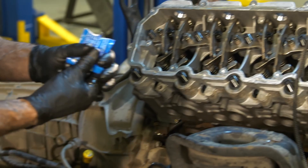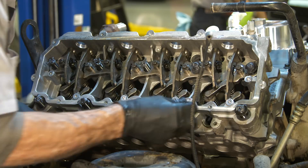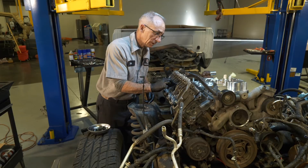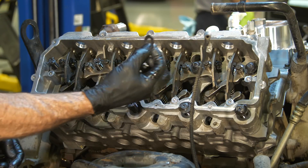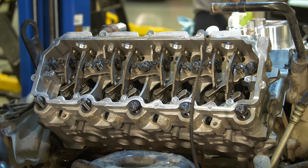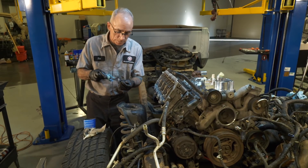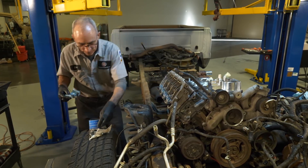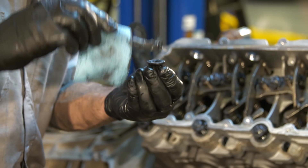Next you've got to lube the studs — you can't use too much. Now we're putting the washers on. They tend to stick together out of the bag, and you can double them up without realizing it. Then you get to the end of the job and you're missing a washer and panicking, so just make sure you only have one in your hand. Then the nuts go on — you can't use too much lube. If you don't have enough, it'll start binding, and if it starts binding you've got to back your torque off and start over.